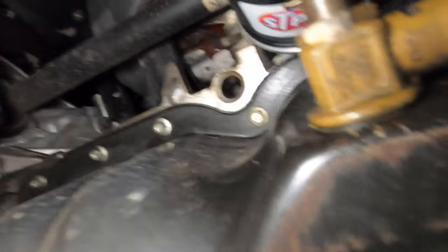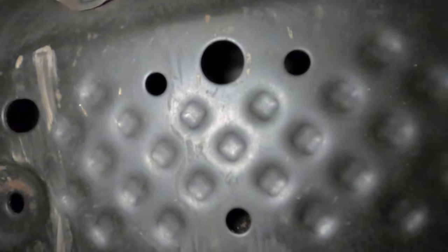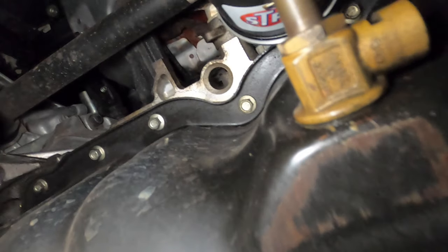Now for the front jack point: this is your front bumper, and that is your oil pan, so you definitely don't want to jack up on that plastic undercover. Right where the undercover stops, you have a piece of metal with dimples, and those dimples are the factory front jack point. Make sure you are on that jack point and not on the transmission mount right there, not on the oil pan, and not on the oil filter. Go all the way past all the plastic to where you see those dimples — that is your factory front jack point.